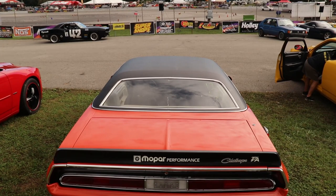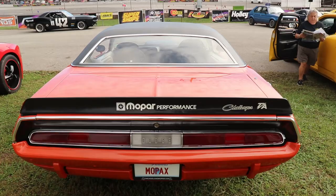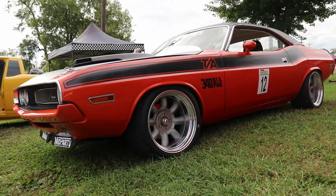along with Delrin bushings. Front brakes are sourced from the Chrysler Cordoba with 11 3/4 inch rotors and Wagner police pads. At the rear, you will find a 10.7 inch rear disc conversion from Dr. Diff. Wheels are ET Mags LT3s, 18 by 11 inches at all four corners, wrapped in 295/30/18 Yokohama rubber.